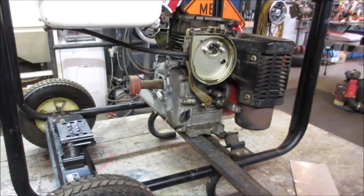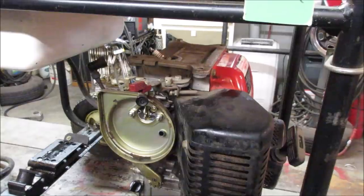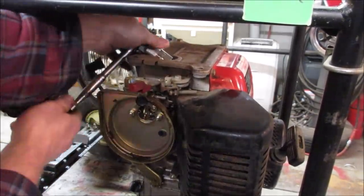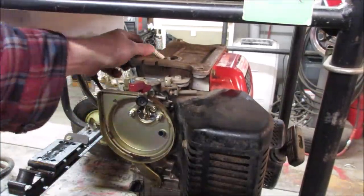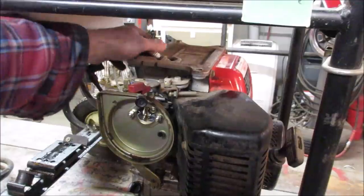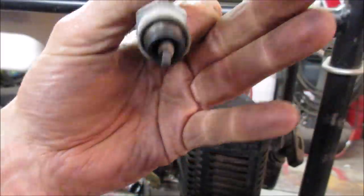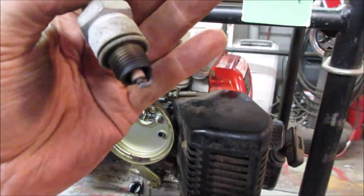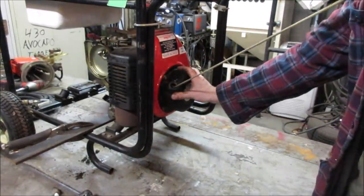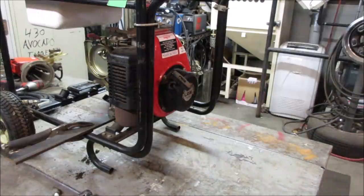Let's throw some vice grips on that, clamp it down. I think I'll pop that plug out of it, to try to get rid of the drag of the compression. We'll see. Just if there are any issues with the engine. It's the gas gauge on that thing making wiggly noises. It's running a little lean. Let's go chug it over a few times, see how it feels. A little chalky. Dribble some oil down the plug hole, lubricate those rings.